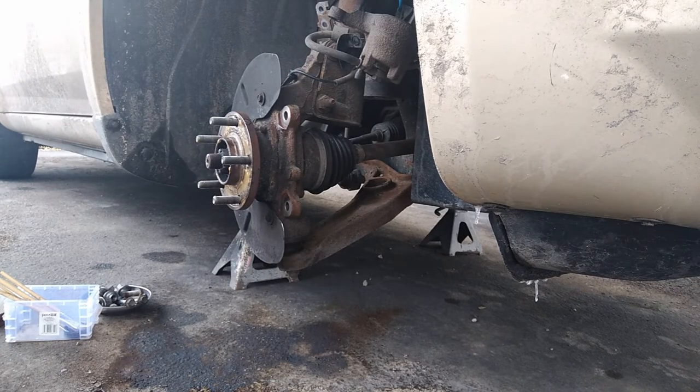When we took these tires off, my neighbor looked at the rotors. He said, oh, they feel fine. No, they're warped. I had this guy down the street do brakes for me about 6 months ago. I was driving to Waynesburg every day, and he told me then, next time you get brake pads, you're going to need rotors. I know the brake pads still had a little life on them, but the rotor was warped, and it developed a wear pattern. So it kind of defeats the purpose. If you would have just changed the rotors, you still would have had pedal pulsation. Yeah, it's better just doing both.